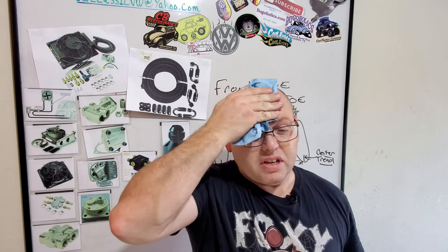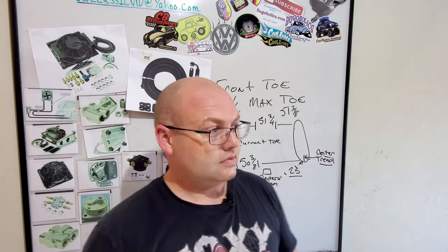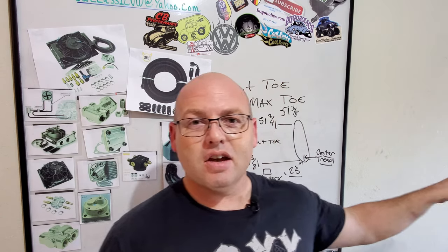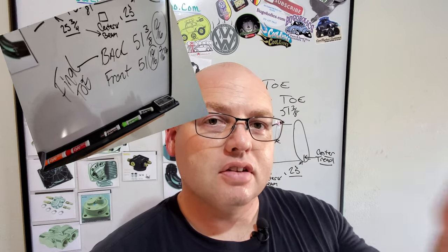Whew, guys, sweating a little bit, for sure. So what happened there is I backed out, went around the block a little bit, came back, let the suspension settle. Gonna check the alignment one last time. We ended up squared away to the center of the beam at 26 inches on both sides, and squared away on the toe too, like front and back toe was almost perfect. Normally when you tighten down that last adjustment, you get that little bit of an eighth from tightening things down.